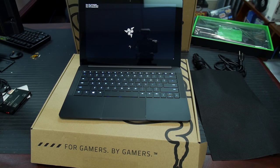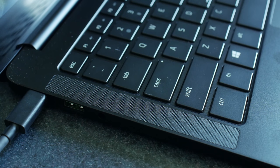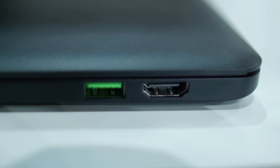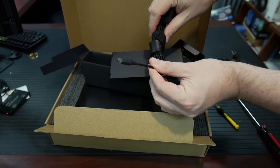It also has a 2-megapixel built-in front-facing webcam just above the display, and the HDMI output is a 1.4B output. It has built-in stereo speakers at the side of the keyboard, and it has an array microphone. It's Dolby Digital Plus Home Theater and a 7.1 codec via the HDMI connector. The bundled AC adapter that comes with this is a 45-watt charger.